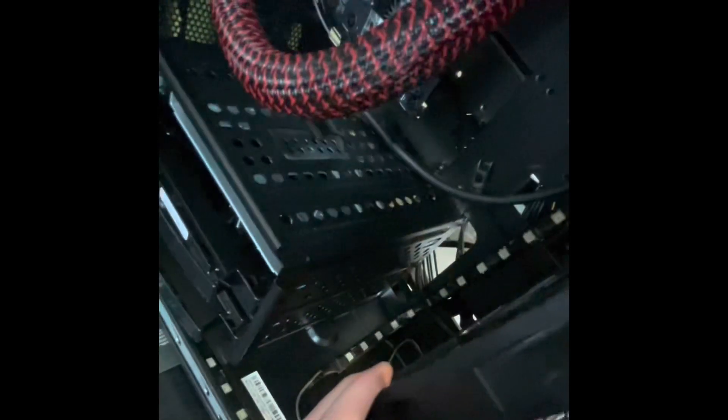So this is what the PC looks like completely naked. I'm going to do the simple part. This part, pretty easy — Phillips that, I think. These fans are a little weird; they connect down there. The top one goes right up there, and the bottom one, pretty sure right there. So obviously you're going to want to disconnect them. I'd also recommend holding the fan when you're unscrewing it — that way it doesn't fall out.